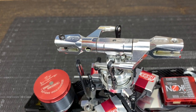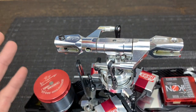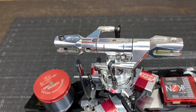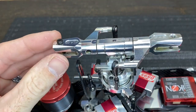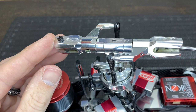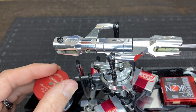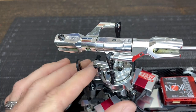One of the first things to check after a crash is your shafts. Looking at your main shaft and feathering shaft, there's no real way to tell if they're bent just by looking unless it's a significant bend — then it's obvious because your blade grip will be visibly off. A useful tip: remove one blade bolt, insert your driver into one end of the feathering shaft, slowly turn it, and watch the other blade grip to see if it moves up or down.